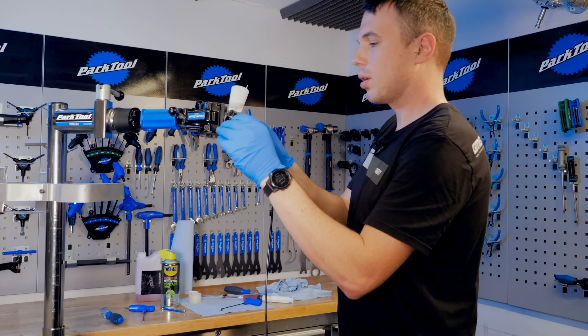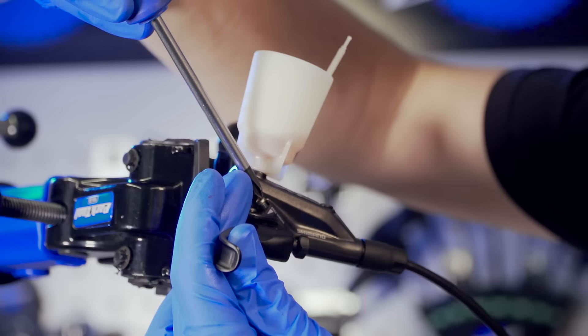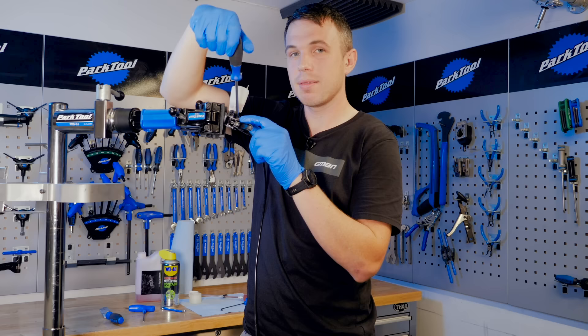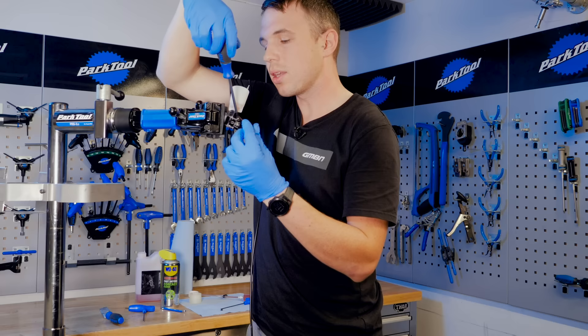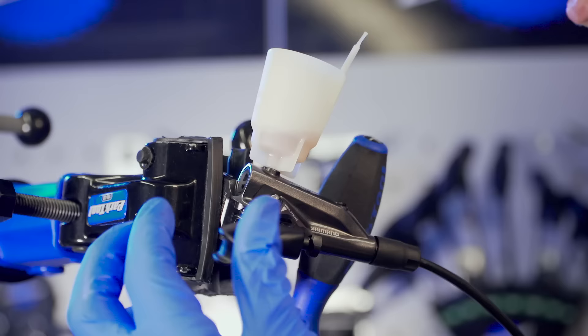Once you've done a bit of that, put the lever back at full extension to increase the volume again and do the same. A lot of people perhaps don't realize about the free stroke adjustment in these smaller brakes. It's really important — once it's fully in, don't absolutely mash it as you can damage the internals. You can see the little bubbles coming out. Then with it fully backed out, tap the lever to do any last prompting.